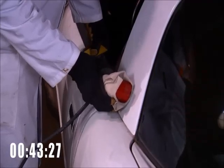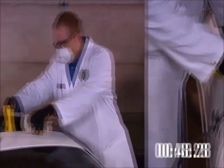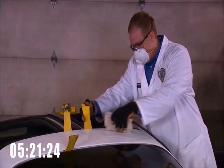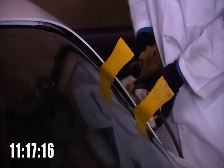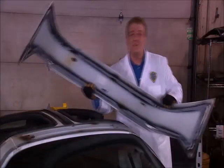Be careful not to heat the metal scraper within the magnet's effective field. SMC panels can't often be salvaged with knives or wire, due to inaccessibility to the angles. Since these panels can be scratched more easily than glass, we want to protect the panel from the attachment with a dry rag. Since finding the urethane bead can often be tricky with SMC panels, we have to bend the panel and look for a reflection of light in the bend, which indicates where the urethane bead lies. This SMC panel was removed in 13 minutes.